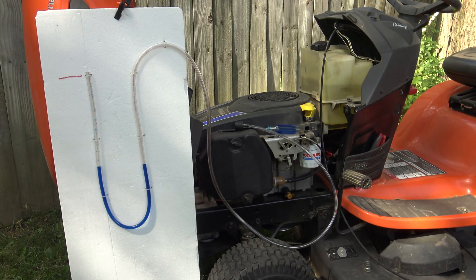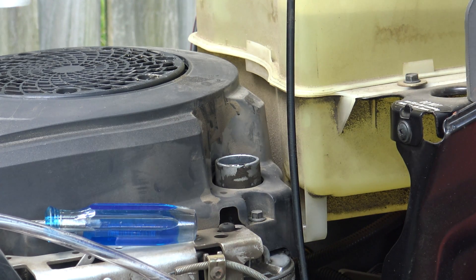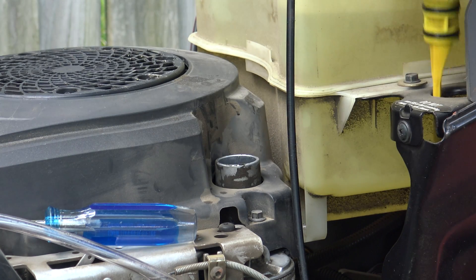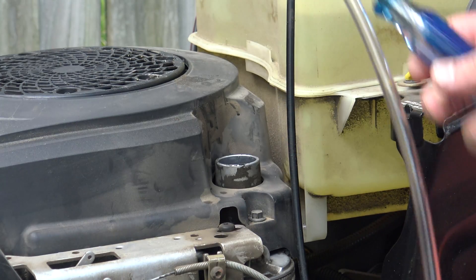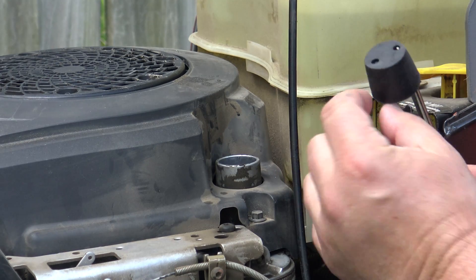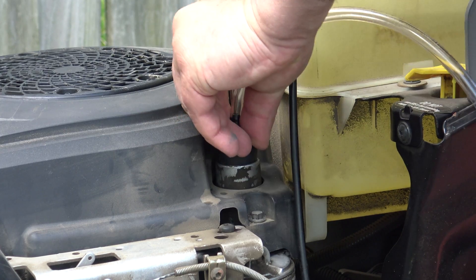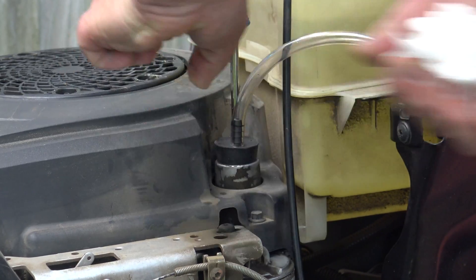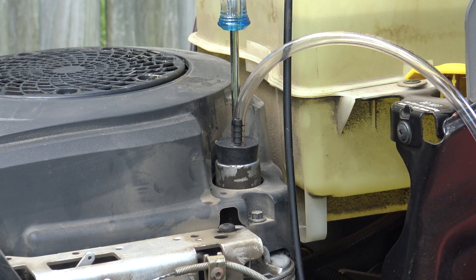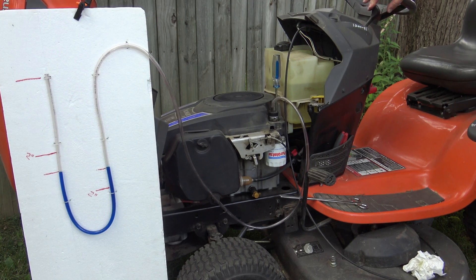I was prepared to measure around four inches of water column, but if you have more you need to make the tube a little longer. I have a rubber cork in here with two holes through it — one I closed with a screwdriver so I don't lose any air. Now we are connected to the crankcase through the dipstick hole.